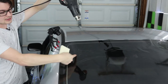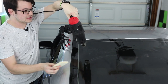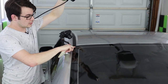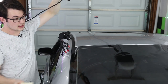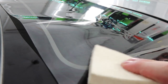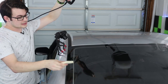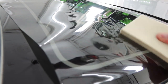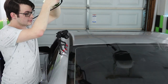Now you see this little diagonal guy right here. This is a prime example of when I'll start pushing it out diagonally. That's where an H pattern is both helpful and a bit of a curse. You don't want to lock it down completely to where you're just trying to shove everything straight up. You can let the tension fall out where it wants to go and shrink a little bit almost on the side, right on this line. And now we've kind of just widened out our H pattern a little bit.